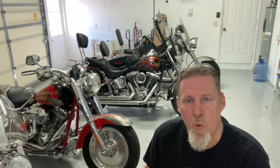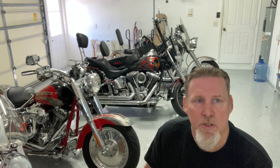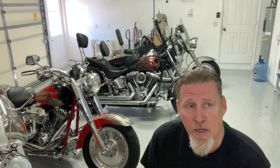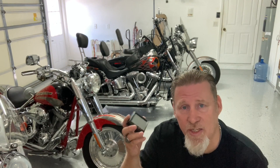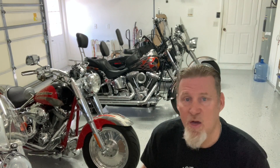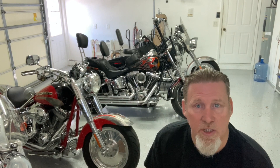I just wanted to go over the tuner situation I ran into. I've had people online ask before — my bike just died — and I usually ask, do you have a tuner on it? A lot of times they do, and it's not the first time I've heard a tuner doing this. That's something you might check on your bike if your bike ever just dies going down the road. Mine got much worse before I changed it. It used to die occasionally, but the last trip before I changed this, I was cruising down the road — 80 miles an hour — and it would just die. I'd shut it off, turn it back on, and it would do good for a little while and then die again. It was getting really bad, so this has been a lifesaver.